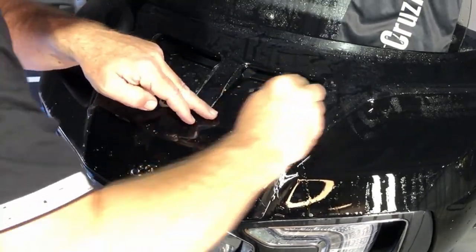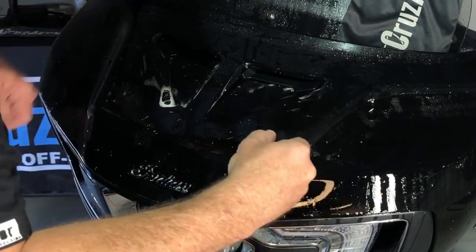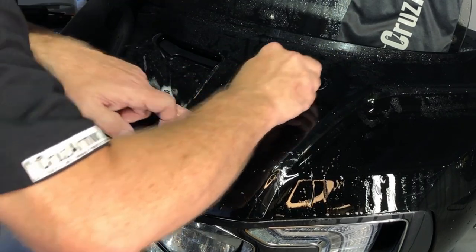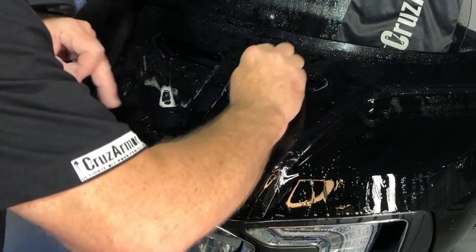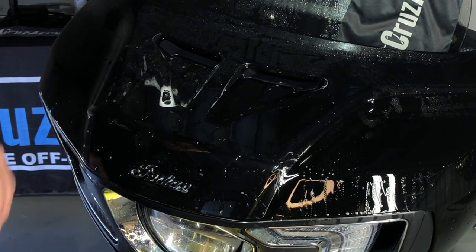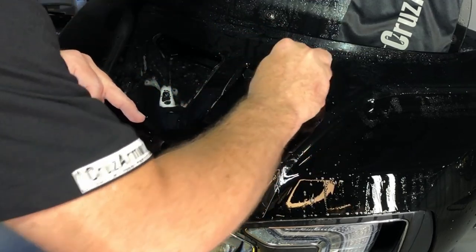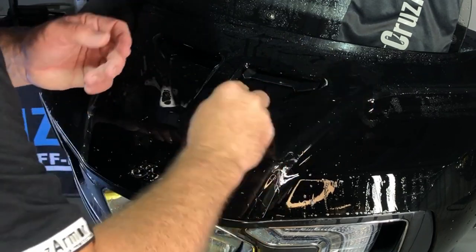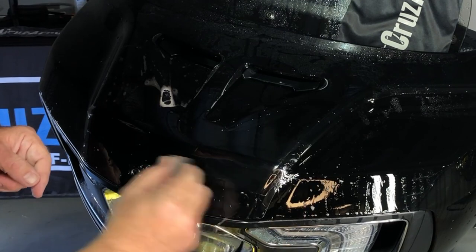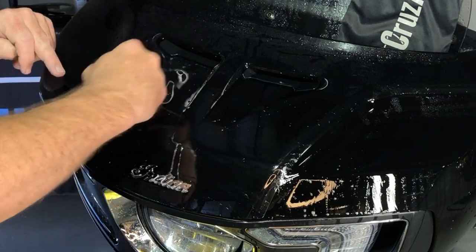Now it's just a matter of working all this stuff into an area where there's soapy water or where we haven't squeegeed at all. You don't want to try to work bubbles out through the alcohol because that's a wall — that alcohol has become a lockdown wall. So now it's a matter of moving everything out where it's safe, pushing everything out this way. These big areas are your main concern — get all the bubbles out of the big flat areas, then work on the edges. That looks pretty good.